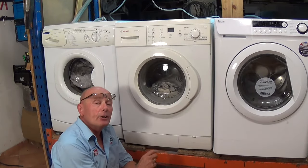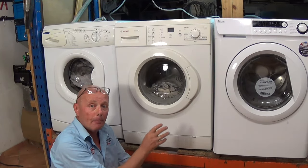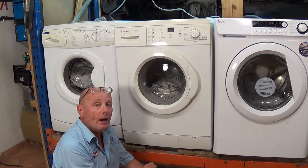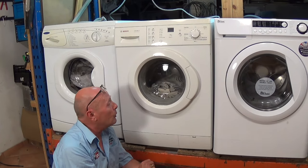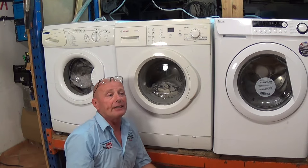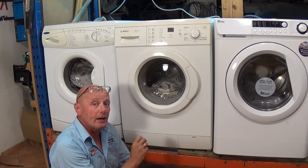This can normally occur for two reasons. Firstly, sometimes people have fitted their washing machines to sink units and water is running back from the sink into the pump and filling this way. But if you've got crystal clear water in the machine, it normally means the water valve is dripping when the power is off. The valve should be completely closed, but due to sediment in the fresh water supply — little granules of sand which builders have accidentally got into the system — bits of silt or sand can jam in the valve.